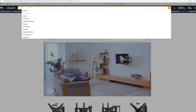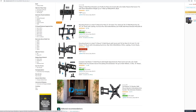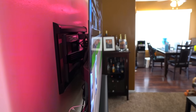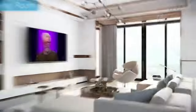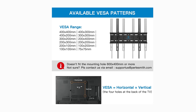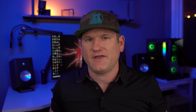Let's go over some of the Amazon mounts, starting with your basic flat mount. You can get a super flush, half-inch-thin static mount, but I don't really worry about that because most people will have a power outlet behind the TV or HDMI connections, sometimes even stuffing lights or game systems behind the TV, so a little space can actually be helpful. But even if you want that flush look, I have a mount that is as flat as any flush mount I would want and can still tilt down if needed — and that's the Pearlsmith mount. It says 32 to 55 inch size, but it can even fit 65-inch TVs because it maxes out at 400mm by 400mm VESA pattern. Anything with that pattern or smaller and under 115 pounds will fit, and the upside is how easy it is to use and the fact that it's only $20.